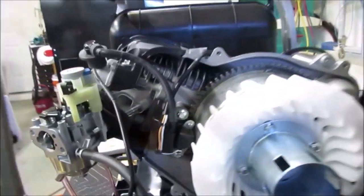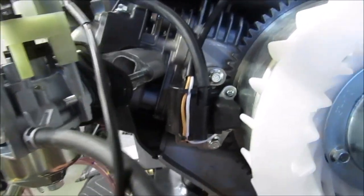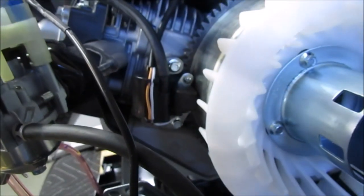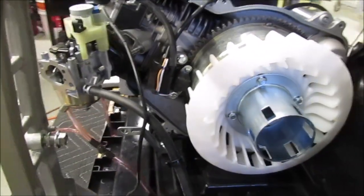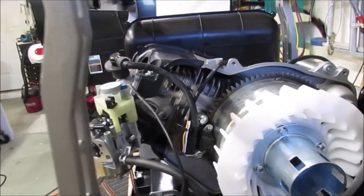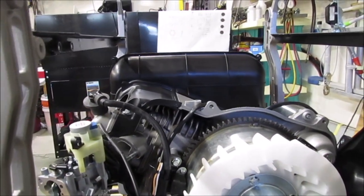Finally got it pushed back and out of the way. I've got two screws here. I took a close look at it — it doesn't look like it's loose. So electrically it's open. I'm sure I should read some resistance through the coil. I'm going to replace the ignition too, because to be safe you really should do it in pairs. A shorted coil could take out the ignition module, and I'm not going through all this work twice.